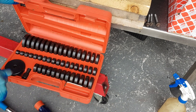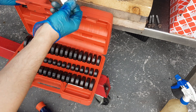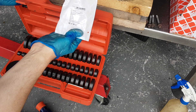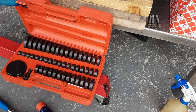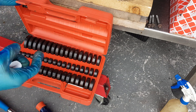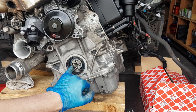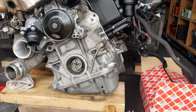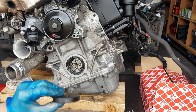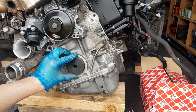This is the set I was telling you about — this is the one I used to push it into place. I'm going to measure the diameter; I think it's something like 55 millimeters. The internal part is around 55mm and the external part is maybe around 68mm. I'm going to take my second biggest shim — I have a 74 and it goes down to 65. This 65mm plate fits perfectly, so we're not going to damage the edge and we'll be able to push it in.